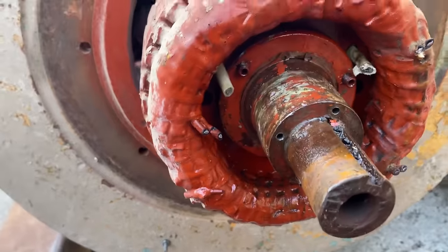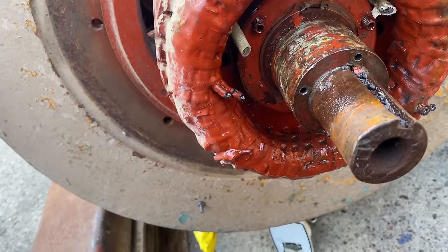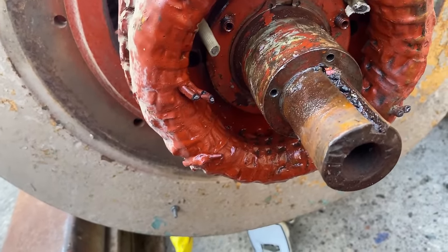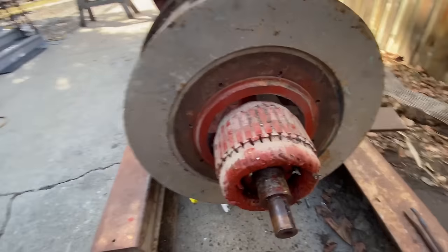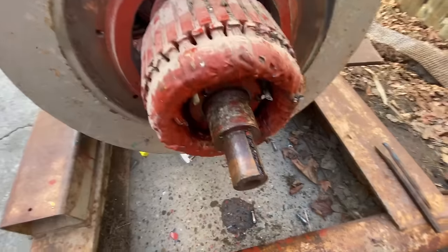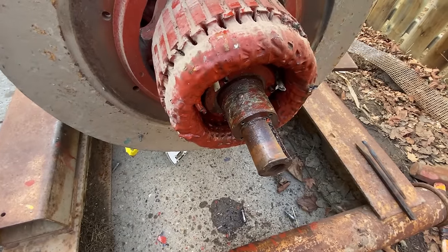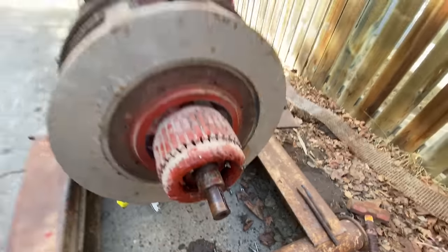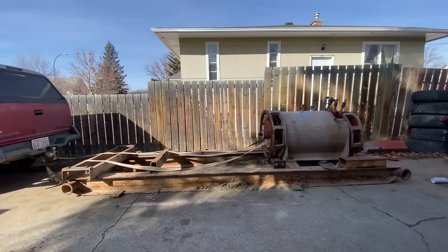So, sprayed the deep creep and uncovered these snap rings. It was just covered in crud, so it cleaned it all up. So I'm just gonna use my snap ring pliers and spread those open, pull them out. So we got the snap ring off. Now we're gonna try, hopefully it's more successful than last week's.